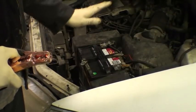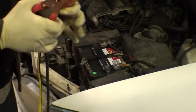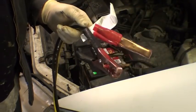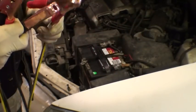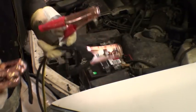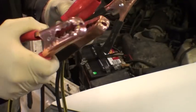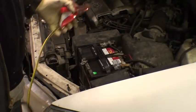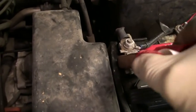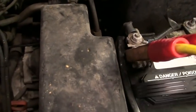This is the good car. I'm going to start with the good car, and you always start by putting on the positive lead first. But here's something to be real mindful of: if these are laying on the ground and they're touching — my little incident earlier was because I had it hooked up to a battery and I touched the two together. You don't want these touching. Hook them up one at a time so that both are not hooked up to one car, and then you've got the other two laying on the ground that could potentially arc and touch. So start with the positive battery cable, and give it a little wiggle when you put it on — that way the teeth from the jumper cables will bite in a bit and make a better connection.